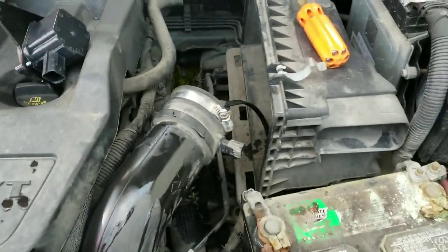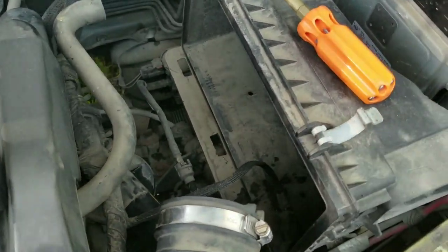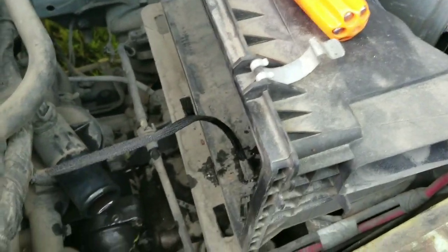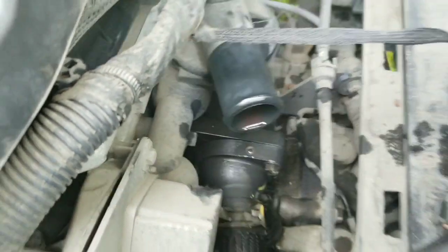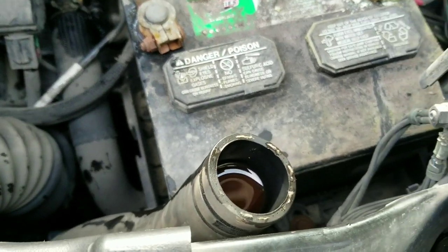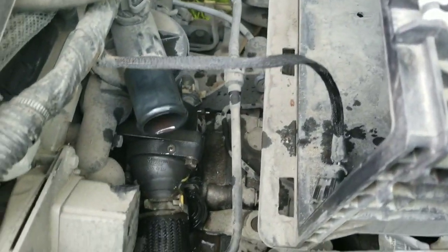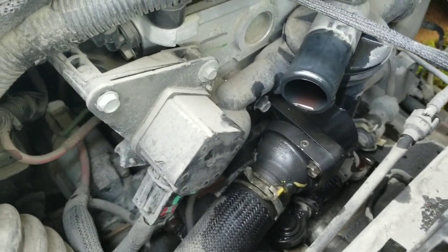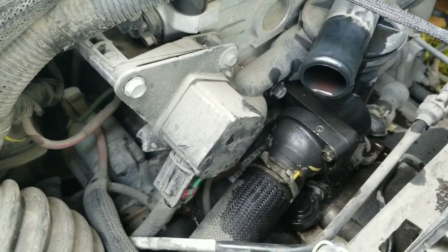So I got into this a little bit more. I ended up taking off the front side of the air cleaner box. I took off the radiator hose and it's just right here facing up — it didn't lose much water but I'll check it before I put it all back together. That really opened up that area around that box, so I should be able to just pull it right out of there now.